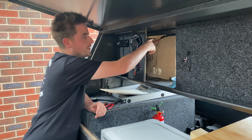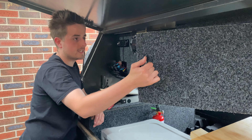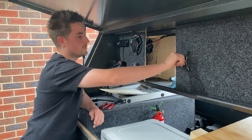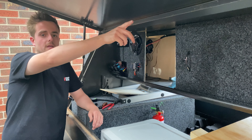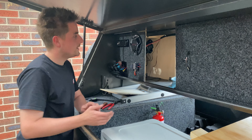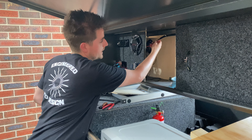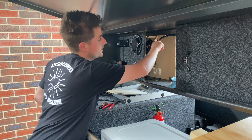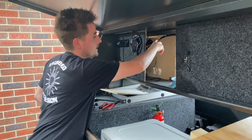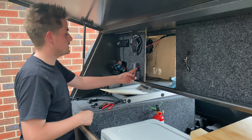I've got the wire round from inside, P-clipped it underneath. I got sick of trying to glue it up there — for some reason it wouldn't hold. In the cabinet I do have to P-clip it up a little bit but I'll have to take the sidewall off and do that later. Next thing I'm going to do is screw the relay up under here. I'll bolt the earth for the lights onto that relay's earth point, then I'll have my trigger feed down here and pick up power from that last remaining fuse.